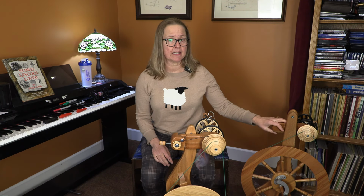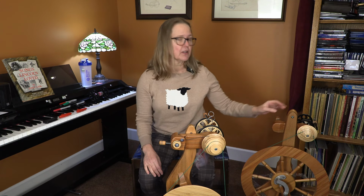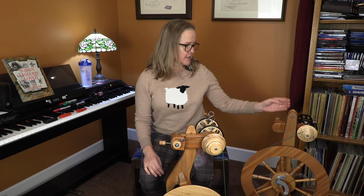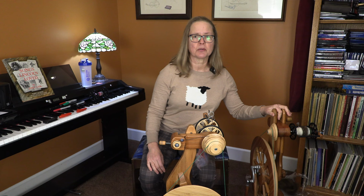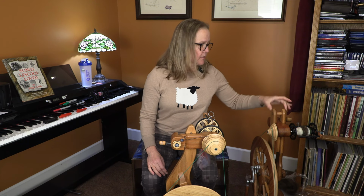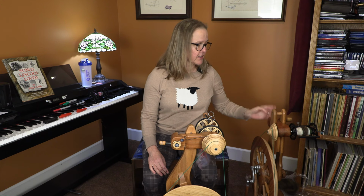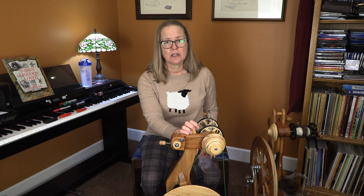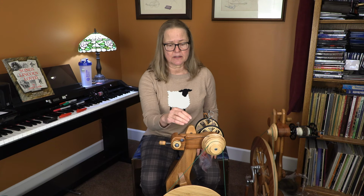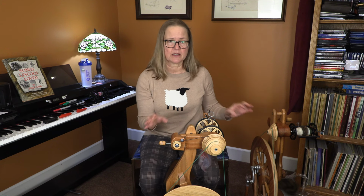The reason you need different types of heads for the Aura as compared to the Rose and Susie is the Rose and Susie's head is attached by means of pressure. So I don't know if you can see here, but there's 2 pieces to the stem that holds the head, and they're just holding it with pressure. On the Aura, on the other hand, the head is held onto the stem by use of a bolt. So it's a different assembly altogether.